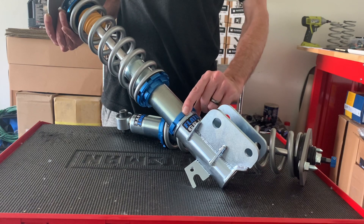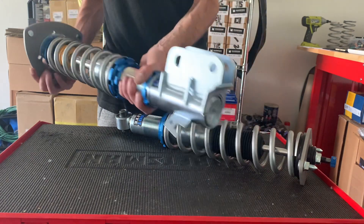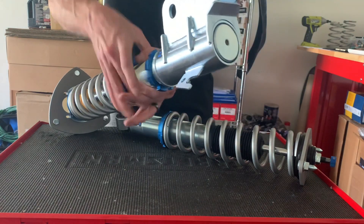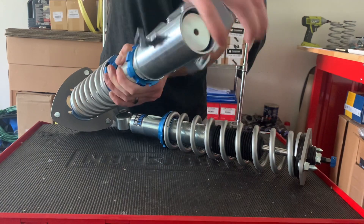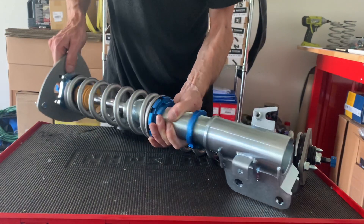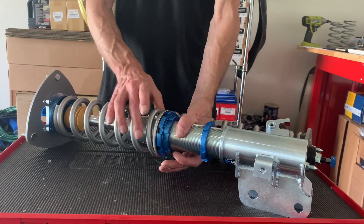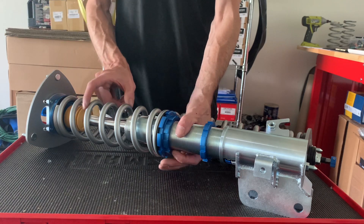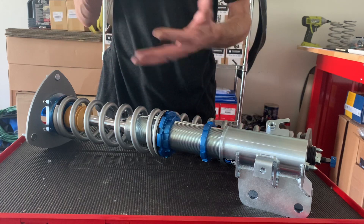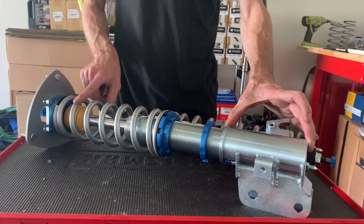When you get this installed, loosen this ring and then rotate the entire body. This will stay in place and you'll spin the entire assembly — as you do that, it's going to start creating a gap at the bottom, which is actually lengthening the whole assembly. That's where you get your lift. For preload, depending on the spring you have — if you have a light spring it's going to compress a little easier — just give it maybe an inch of preload to get some bump travel back. But don't force the spring all the way up, or when you take a tire off the ground it's not going to articulate. Use spring preload as a last resort; if the body height mount doesn't get you enough, get another inch out of this, but don't go any more than that.